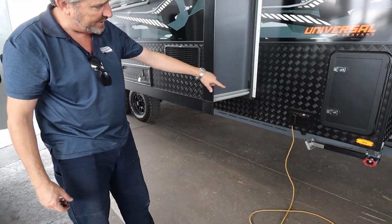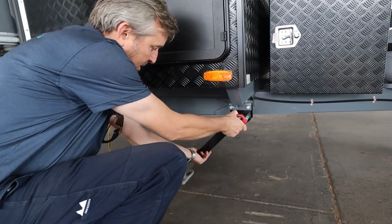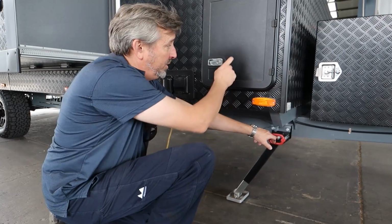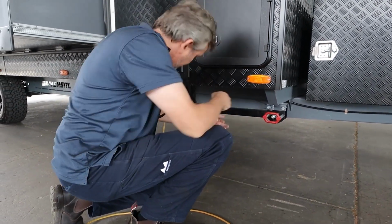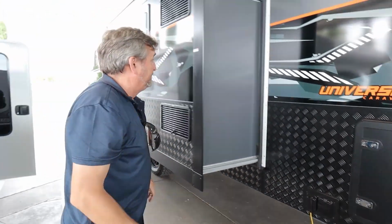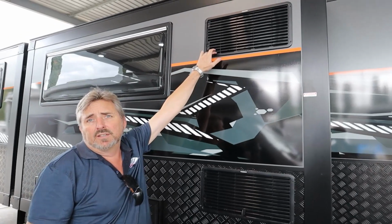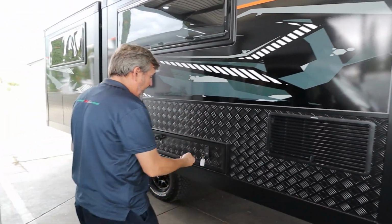Your stabilizer leg, very easy. Take the weight, pull the handle, drop the leg down to an angle, or vertical is best. There's a bar in the boot, so tension it up or down. Make sure you put it away from travel. We're sick of replacing them. Fridge vents, keep them clean. Try not to squirt up. Sounds obvious, people do it all the time.